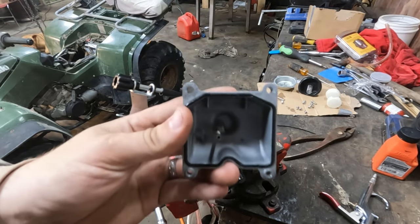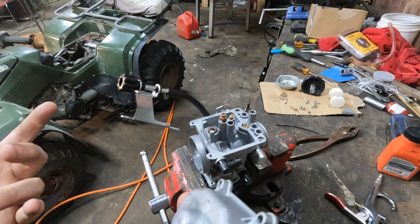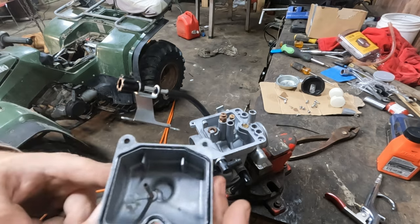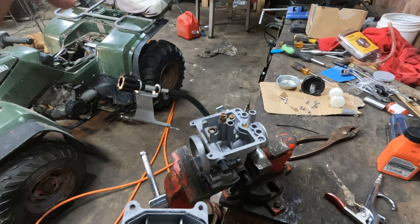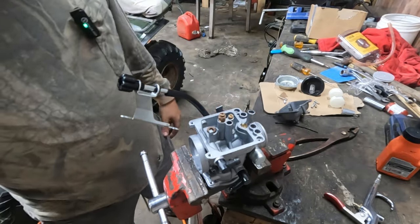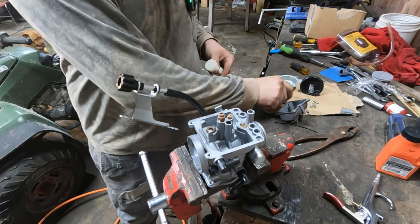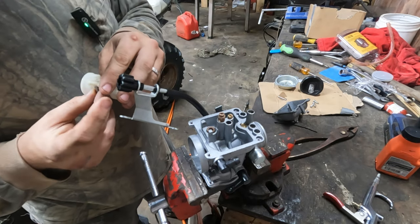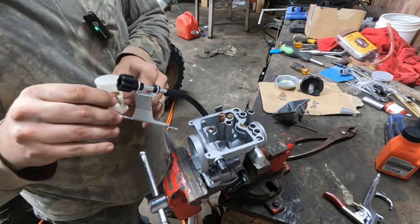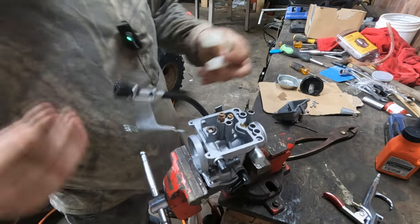When I got this, somebody had kinked this overflow hose because it was leaking gas. Don't ever kink the overflow hose — if it's leaking gas, what will happen is it won't drain out the overflow tube. It'll fill up the carburetor, fill up the air box, and potentially fill up the motor with gas in the crankcase, which could cause a lot more damage than losing a little bit of gas. Don't ever plug your overflow — if it's leaking, it's leaking for a reason. That's saving your engine from overfilling with gas, and it could be dangerous.